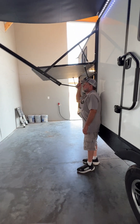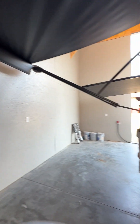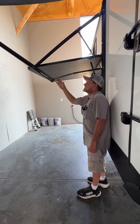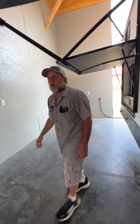We'll come out here and pull down against this bottom arm, which puts the pitch of the rain coming off this back corner. Same way with the front arm — you can put the pitch coming off at the front. But when you get ready to roll the awning back up, you'll want to push it back up into the straight position so that when it rolls back up it fits right into the cradle on the front and back arm.